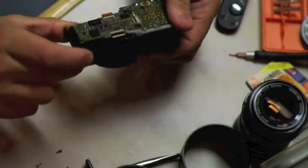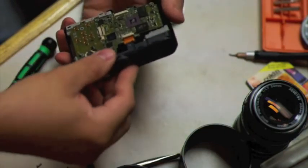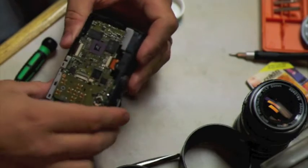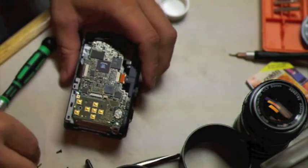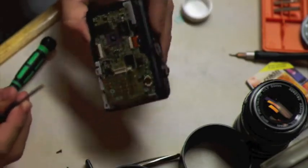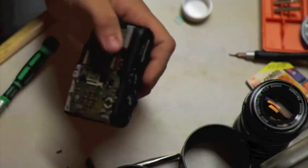A piece that can also fall out on you is the bottom tripod mount holder. Once that's back in there, you take the top — the top goes back on and you have to lay the front end first with the flash and snap it in. Make sure it doesn't interfere with that cable; I had it knock that cable out yesterday. Make sure it's snapped in place and fits flush on the front. Then put that little screw back in. The trick is to put the screw on your screwdriver, turn the camera upside down making sure the circuit board doesn't fall out, and go in from there.